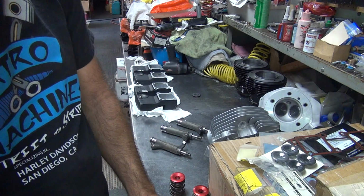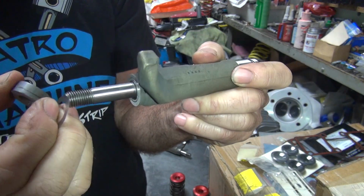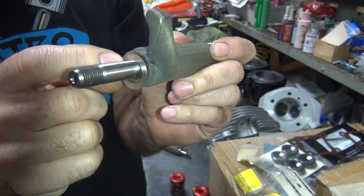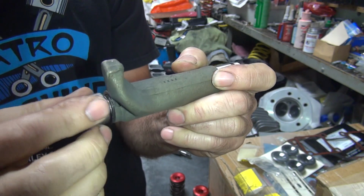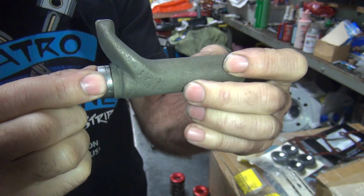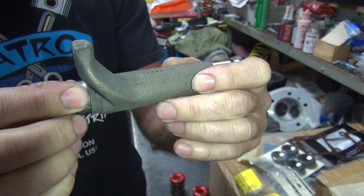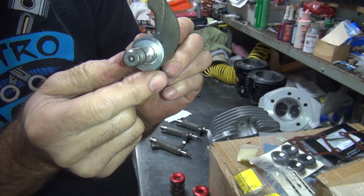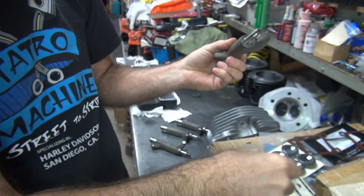It's the thinnest one. Now, if you put the shim right here, when you assemble a rocker arm, if you don't get it on top of that shoulder just right, it'll sit down. When you tighten it up, it'll still be loose, or it'll take a little shear, the washer, and jam up the rocker and lock it up. So you never want to put the shims on this side because it's free to float up and down on here. What you really want to do is take the whole thing out of the box, quit being lazy,